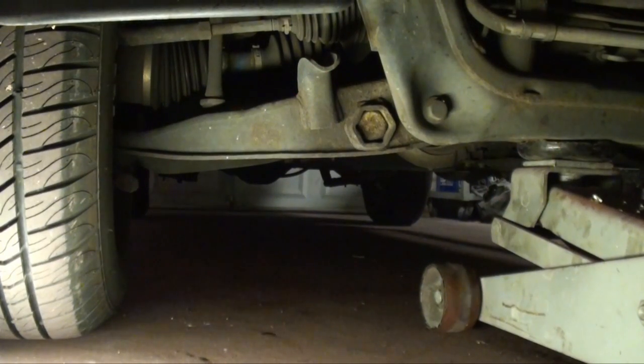The first thing I want to demonstrate is how I go about jacking up the vehicle to check the ball joints. First I'm going to show you jacking up on a cross member, which will lift up the whole vehicle, similar to if you have it on a lift.